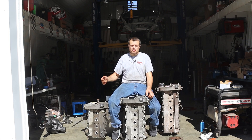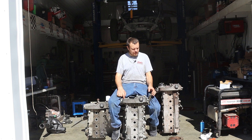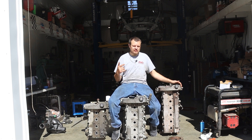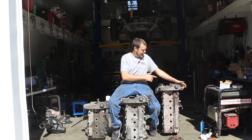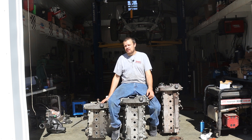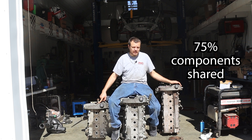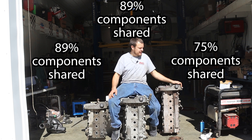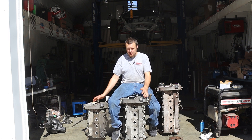These engines were produced in the early 2000s and were meant to be a modular inline platform for light truck and SUV applications. The 4200 in particular was meant to replace the 4.3-liter V6 and offer a lighter, more efficient, and higher power production platform. If you're making one engine, why not make two more that share the majority of their components. The inline 6 shares 75% of the components of the 4 and 5, and the 4 and 5 share 89% of their components with the inline 6, so a lot of the parts that fit a 4200 will fit the smaller 4 and 5s, and vice versa.